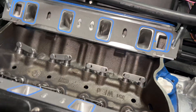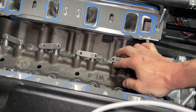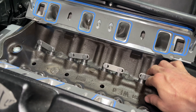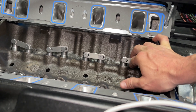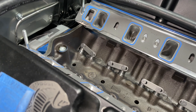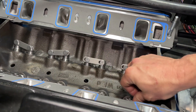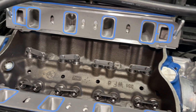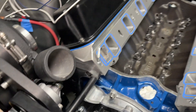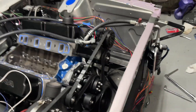I'm sure some of you are wondering where my push rods are — I sent them back. I ordered 80-thou wall thickness push rods and found out I should have been running 120s. That's part of the reason I didn't install the intake until after the engine was in, because in these 351s there's a chance they can completely come out. Those back ones after trimming were probably not necessary at all — no water goes through them since the head gaskets block them off on the back, so that was probably a waste of time.